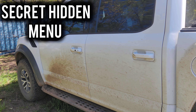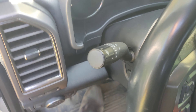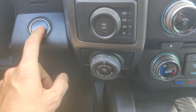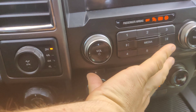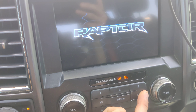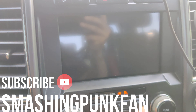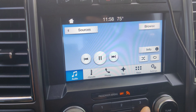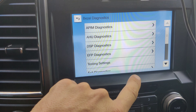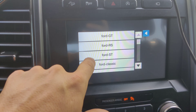This is one of the coolest features about the F-150, and it's not just the Raptor — it can be in the King Ranch, the Lariat, the FX. If you have the screen in your truck, don't press the brake. Press the start button, hit the gas, then hit eject and press and hold. It'll take about 30 seconds and you'll see the secret menu come up. Then hit 'Test Settings.'